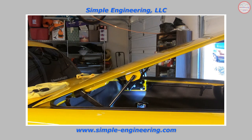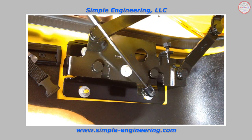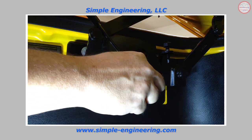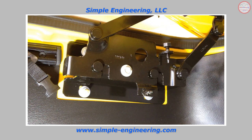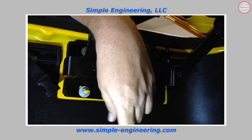My wife will act as my assistant — if she would grab the cargo cover, it's going to get a little heavier as I pull this off. Okay, that's the top side. Now on the driver's side lower section, we just need to pop it off — it may need some motivation, let's give it the screwdriver. There we go — the old strut is off. I'm going to install the new strut by simply putting the bottom side in on the hinge. That's snapped on and it's secure. Now let's proceed to the passenger side.